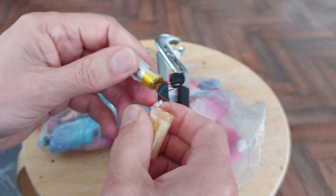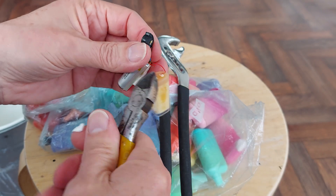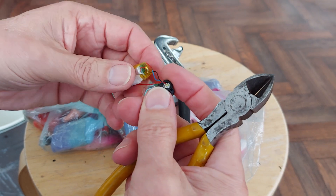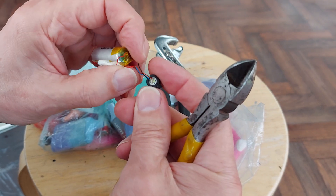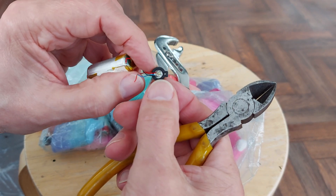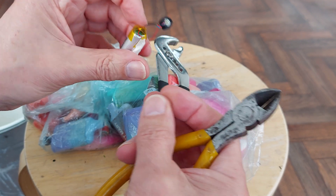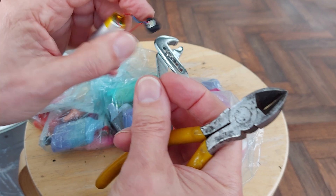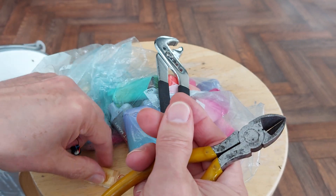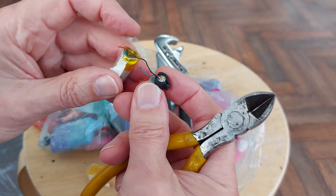What I would normally do is cut these off. I do have a use for the sensors — I've got probably certainly dozens of them, if not hundreds of them. They act as a little 10-second timer. When you trigger them, they run for about 10 seconds — they send current down these wires to the heater to heat up your liquid, and it runs for 10 seconds. So if you've got something that you want a 10-second timer for, you can use these.